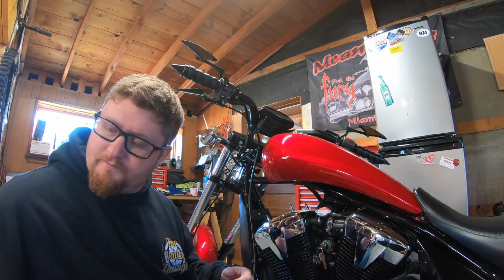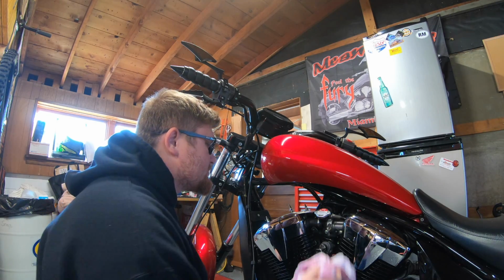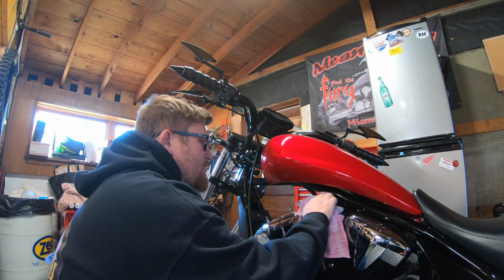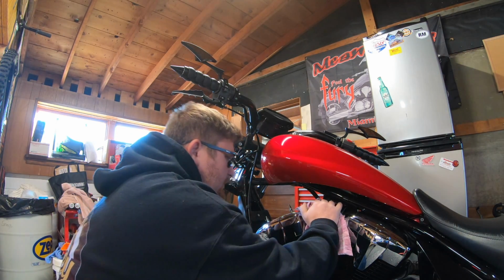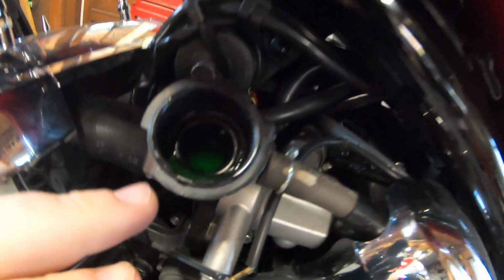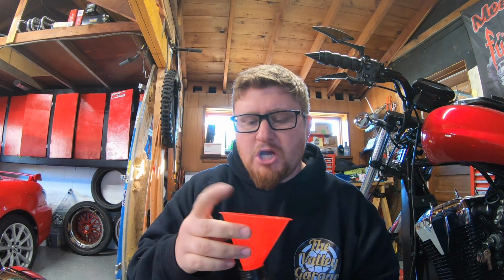All right, that's about a minute. I'm slowly killing myself with the exhaust fumes. A little bit warmer now. I'm gonna take the rag, put it over the top, give it a crack, some small turns. Heard a little gurgling sound, so that's a good sign. And if you look, the coolant is right to the bottom of the neck. We are so close. I'm gonna pour just a wee bit more. I'm talking a couple more drips.